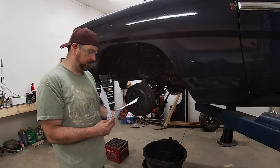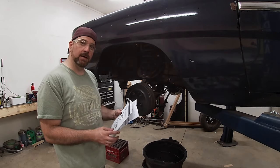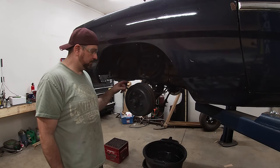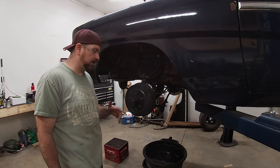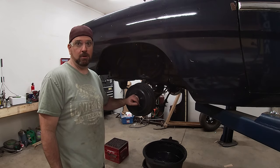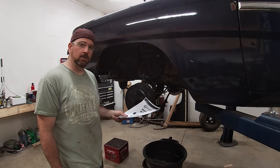DBF193. Again, it's for a V8 automatic front power disc brake conversion. The reason they say V8 is that the six-cylinder spindles on a Mustang are different. Basically, you can also tell if you've got five lugs or not. So this is for a five lug. This Fairlane has five lug, so it's already got that spindle on there, so everything works just fine.